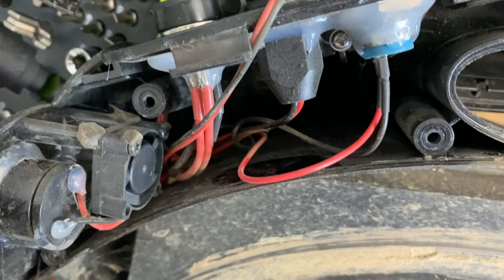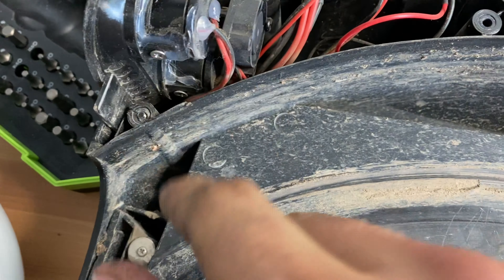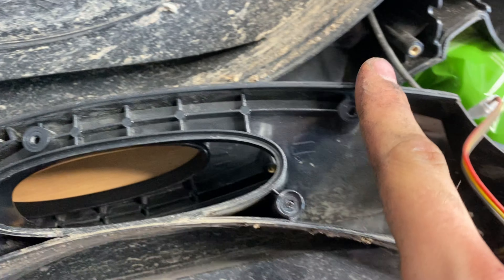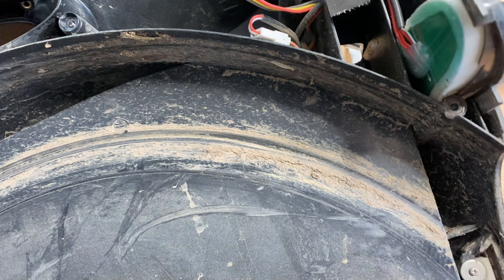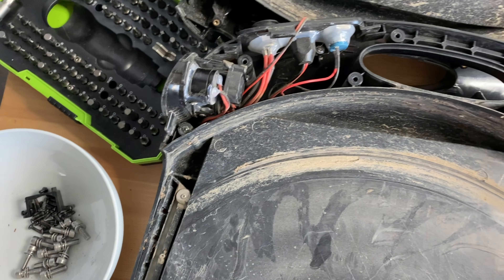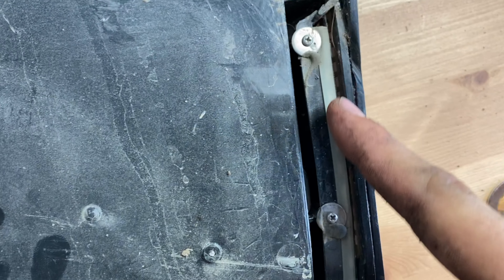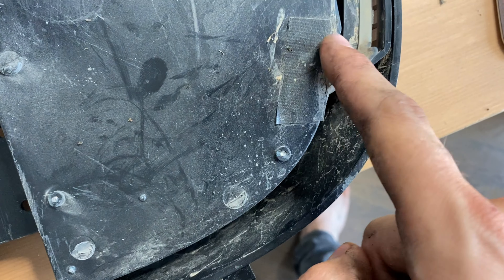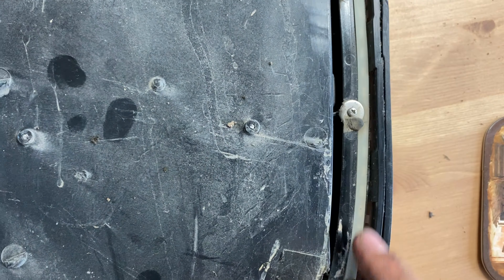On the inside I'll try to seal off the light since it doesn't have any seal in the front. There's also a small seal area around the charge port unit — no seal there either. I'll go all around this crease and around the backlight and hopefully it will be fine. I'm also going to silicone these lights off because there's a channel somewhere that goes to the inside, so this will all be gooped off, front and back.